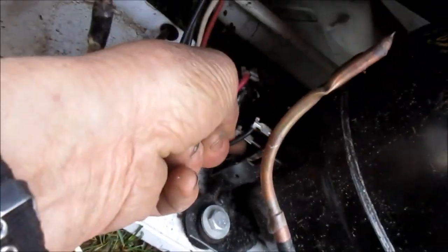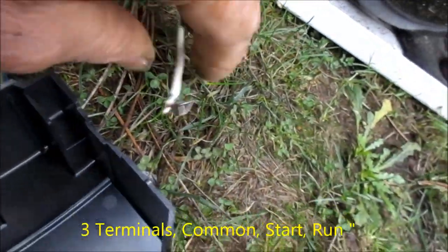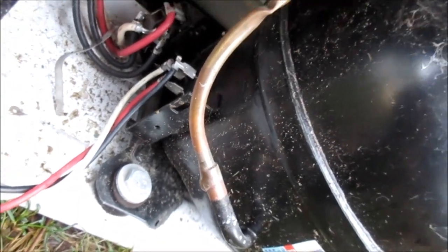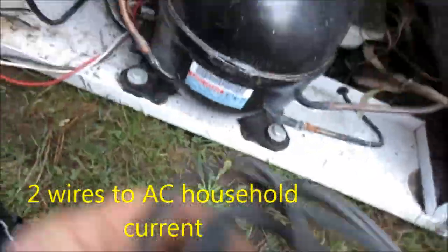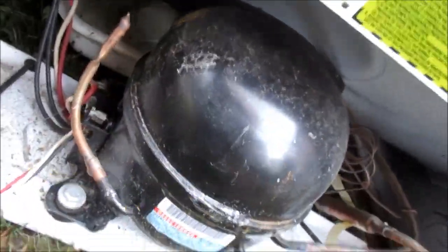They just slip in here like so. The last one on the list is going to be the start winding, and that's the white wire. The white wire is like a little pyramid, and the middle terminal is the common — black. The red is the run and the white is the start. So now all we have to do is hook these two wires up directly. I've got a patch cord here. We'll hook these two wires up directly to this patch cord. If the compressor comes on, it's either going to be that capacitor, the relay, or the switch in the front.